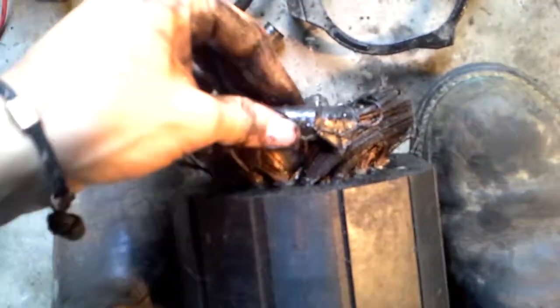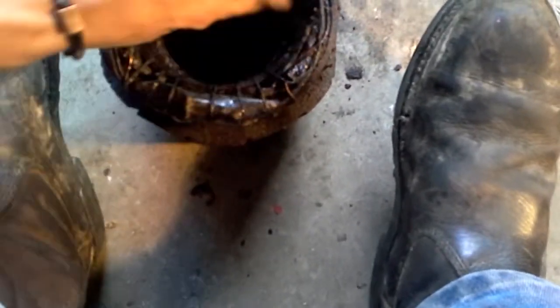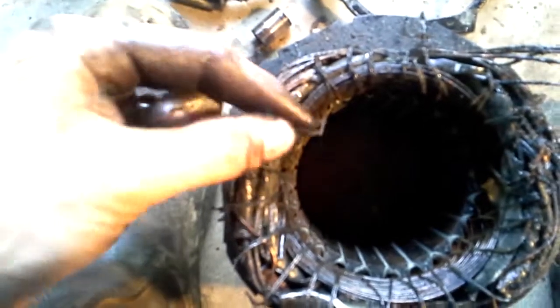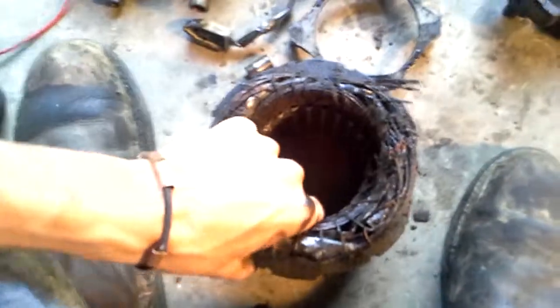The stator wires actually burnt right off here — that harness would plug onto that, which is why the top is all charred. The only other safety on this is a thermal overload right here — that's your thermal for the windings. If it gets too hot it'll open up the winding set. All the other little binders just connect the windings through. That's where all the black comes from — the arcing literally just melted right through the wires and took the binding off the windings. The bottom end still looks clean because all the arcing happened on the top.